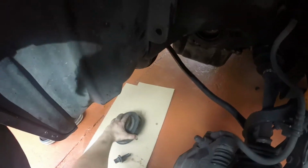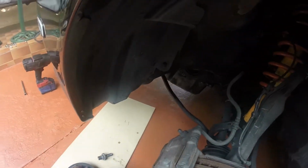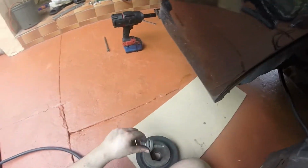Thank God. I thought we were done. Well, definitely don't tighten it that much next time. Jesus, it's hard in there. That's the beauty of this compared to the Supra. The Supra, you gotta get your pulley bolt out and then get the puller, instead of just doing this. And the key's also way smaller, so you can lose the key.